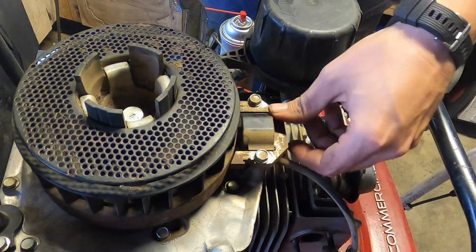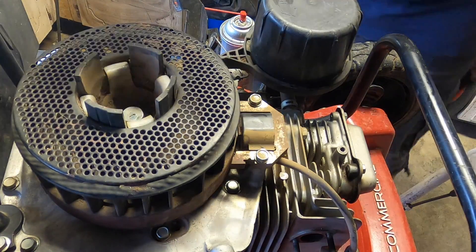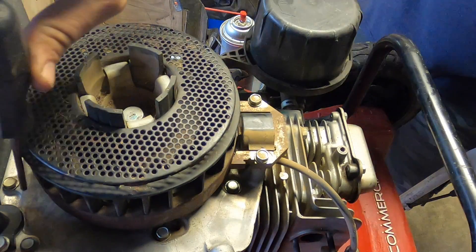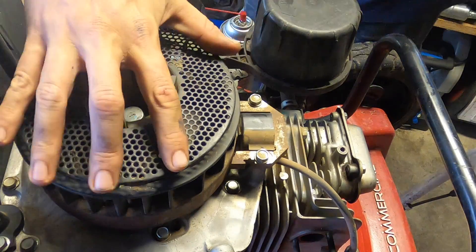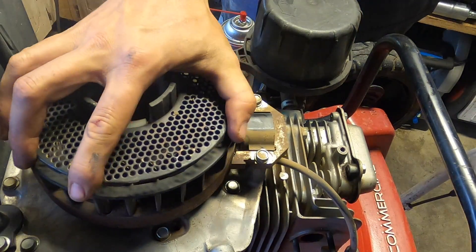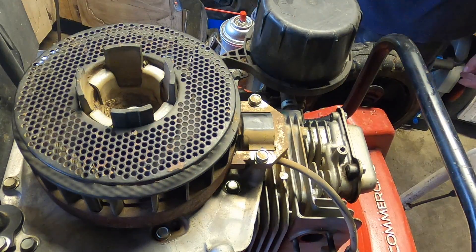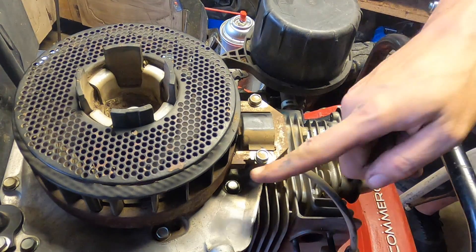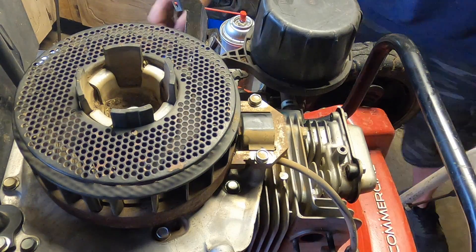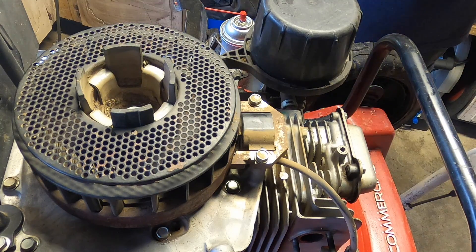So the very first thing is that's finger tight. I'm going to pull all the way back. Take a screwdriver and find your magnet — that's my magnet right there. Now this is the part that differs: every coil is going to have a spec you need to follow for the gap. And when they mean the gap, they don't mean the gap from the flywheel — they mean the gap from the magnet, because that can be different. The magnet can protrude a little bit, so keep that in mind. When you do this, you always do it off the magnet.